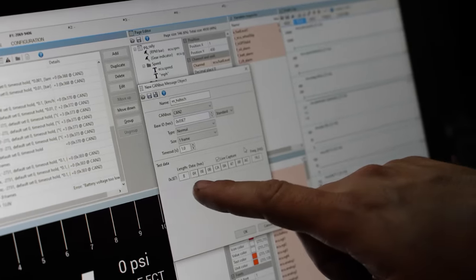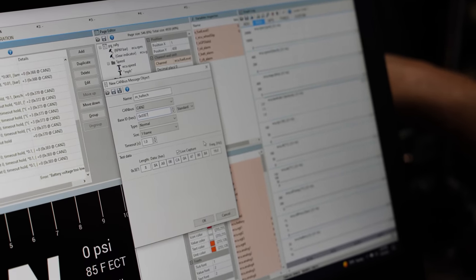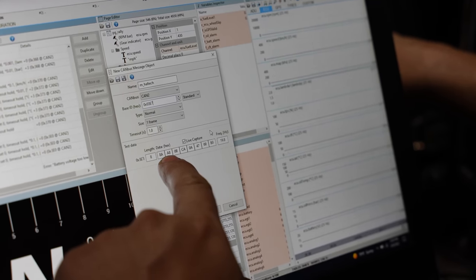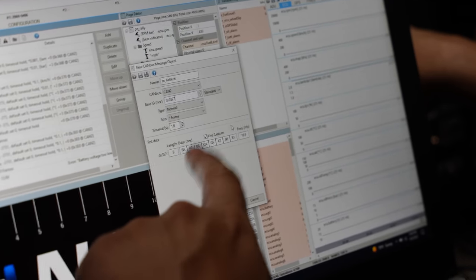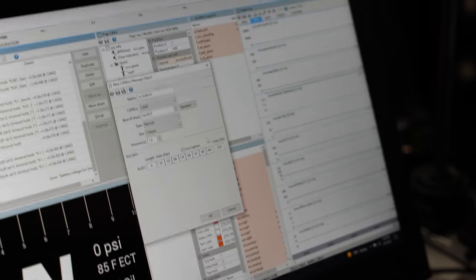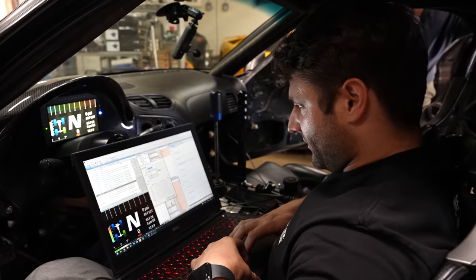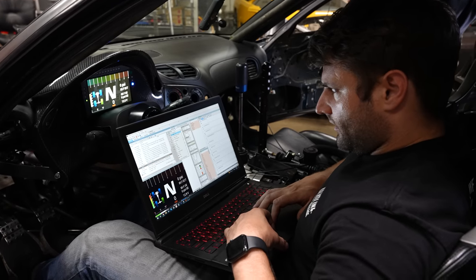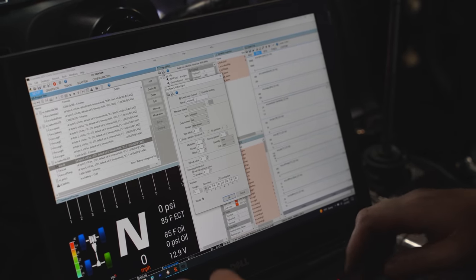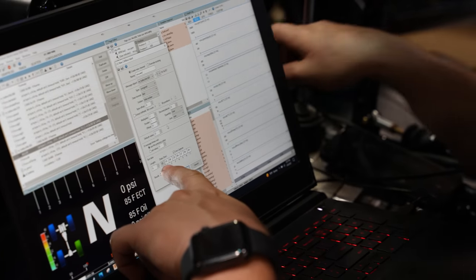And so this is like the old Game Genie. I'm actually gonna be looking at these and watching when I press the all-wheel drive system, those numbers change. See that? 04, and those went all the way up to 8A. That right there, sensor one, which is the first two digits here, or first two blocks, is the sensor I'm looking for. The ECU Masters has a lot of the stock setups already, but now I have to add a CAN bus input. ECU all-wheel drive. Well, all I did here was 3E0 plus 7, apparently, so it's 3E7. So then there's that data again.